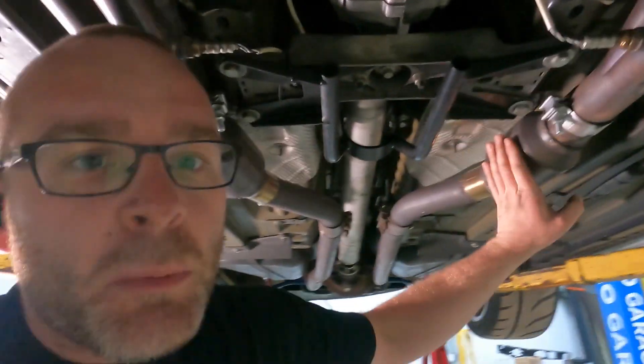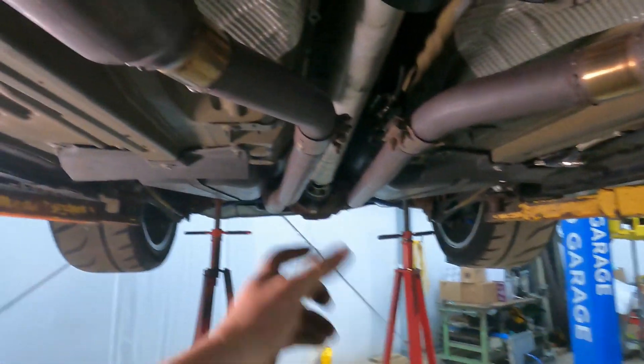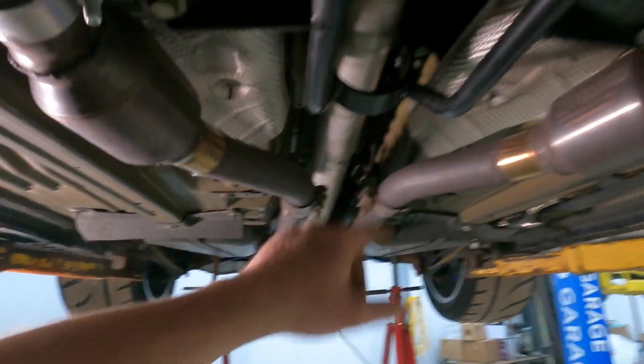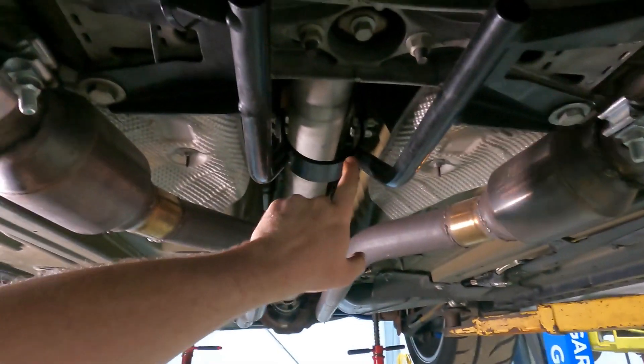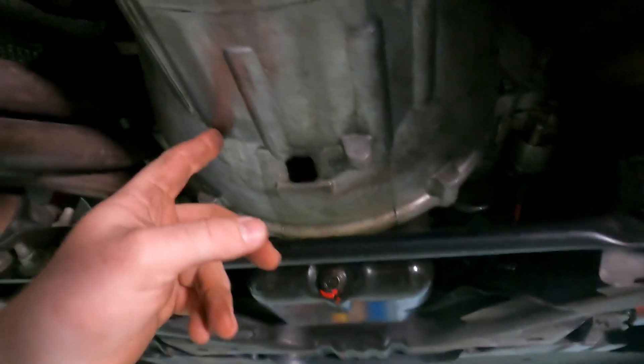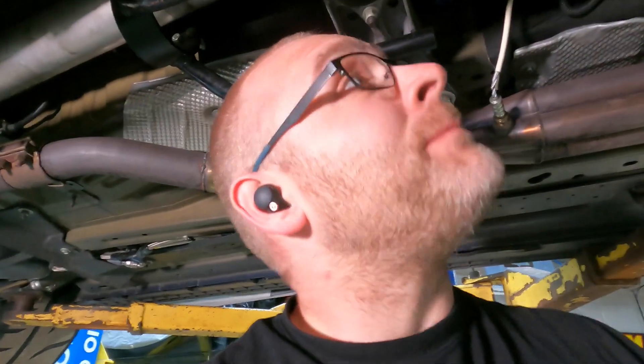As you saw in the time lapse, we got it up on the hoist and this thing is absolutely spotless underneath. First thing we're going to do is pull the exhaust — it has long tube headers, so we'll pull this clamp, pull this clamp, slide the middle section out, same over here, and pull the drive shaft. Next we have to come up front and pull the transmission cross member and the drive shaft safety loop — this little one here — so that if your drive shaft breaks it catches it and won't catapult the car. Then we pull this little cross member and we're ready to pull the trans. As you can see, we have some drips right in there coming out of this hole, which probably means the throwout bearing we put in brand new last time is dead.